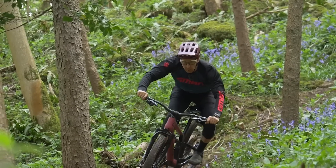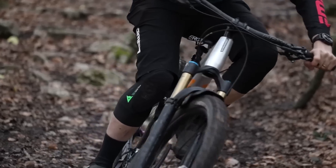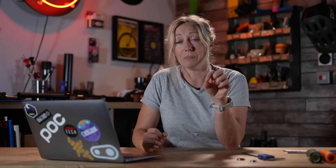Also, you're doing this to create a mullet out of a 27.5, and even if you're happy with all those geometry changes, I've just got to ask — is it worth it? If you have to put a 160mm fork on your bike to get a 29er wheel, is that really better than having the 170 or even the 180 if your frame can go up to it? Maybe go on some demo days and see what you think about that setup first, because it's quite an expensive change. The first point of call is contact your manufacturer and see what your frame can actually take.